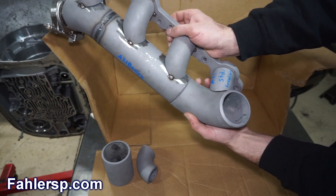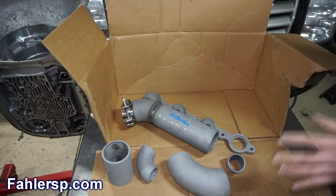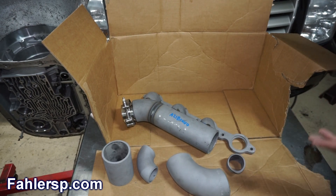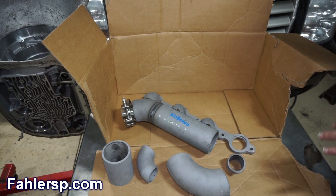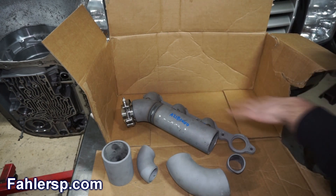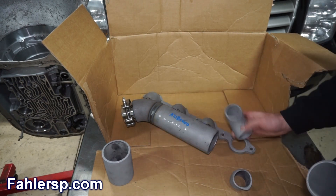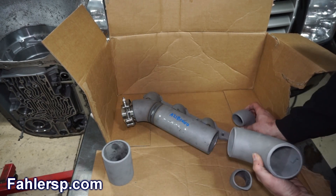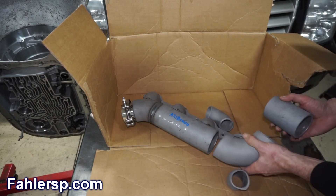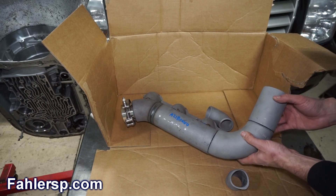There it is with the pipe in there. This is perfect because I don't really even know what turbo I want to put on it yet — if it's going to be a T4 or a T6. So it kind of just leaves the door open for me to set it up exactly how I want it. I'll be able to finish weld this stuff, bolt it up to my extra engine to make sure the flange stays flat. I could use this piece or that piece to position this wherever I want based on the turbo and then change the height.